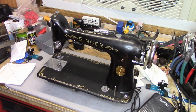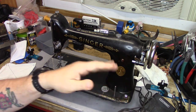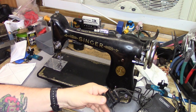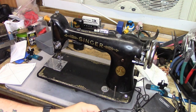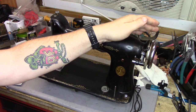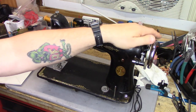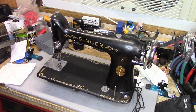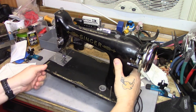I'm not a big fan of plugging something in willy-nilly, but I did look at these wires and they appear to be okay. It's all going to get rewired, but the power connector block has open terminals and screw terminals, so I put a piece of electrical tape over that. I just wanted to see if the motor was going to run, which it does — it doesn't run well, but it runs. I'm going to unplug this now so we don't take a chance of zapping anybody. As long as we can get the motor to turn, I'm pretty sure I can restore this.